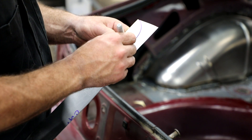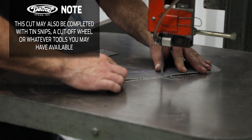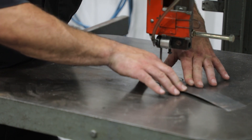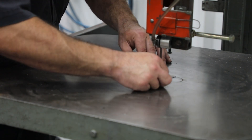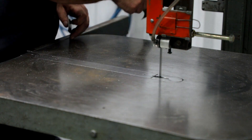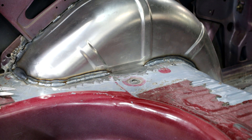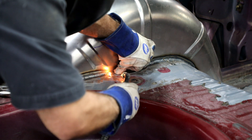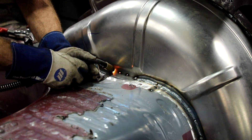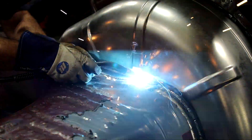Use template paper to trace the open shape left from the upper shock mount bracket in the trunk floor. Use some of the sheet metal that was removed from the mini tub and cut out a closeout piece using a bandsaw. Place the closeout over the hole in the trunk floor. Tack weld the closeout to the mini tub and trunk floor and then finish weld. Repeat this procedure for the opposite side of the vehicle.